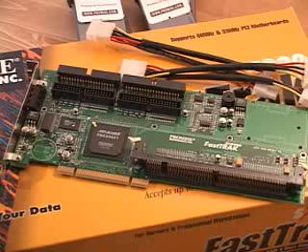If you want the best of both worlds then you can go RAID 0 plus 1, which is striping plus mirroring. That combines RAID 0 and RAID 1 together, increasing performance by reading and writing data in parallel while protecting data with duplication. One important thing to note: you need at least four hard drives to get RAID 0 plus 1 to work. However, if you want backup, security, and performance all in one, RAID 0 plus 1 might be an option for you.